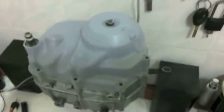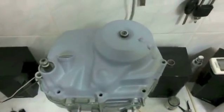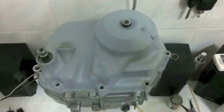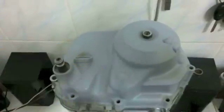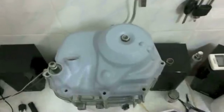That is that. Lastly, I will get to the clutch adjustment later, but perhaps for another video. Once you've bolted down your cover, I don't use much torque actually. I just have a quarter inch ratchet, and I'll just grab the head and give it a snogging down with the head. That's it. I don't use the handle at all. I don't need to put a lot of torque down, and that is enough torque to hold down the clutch cover. There's no need for more than that.